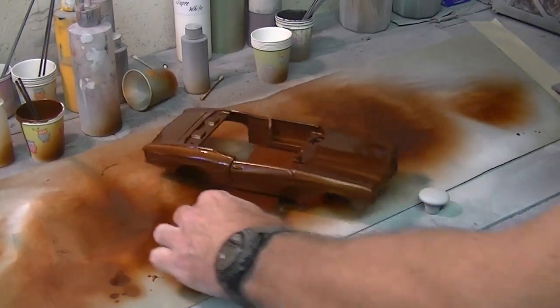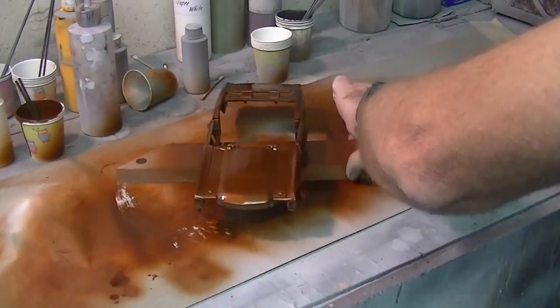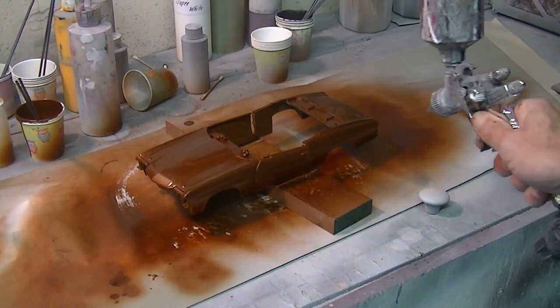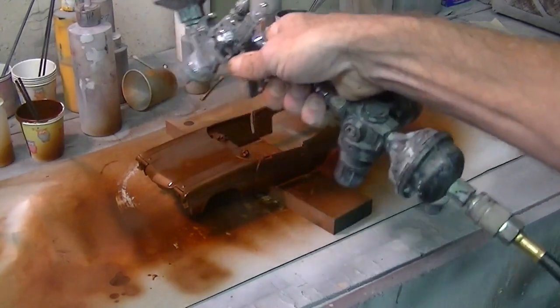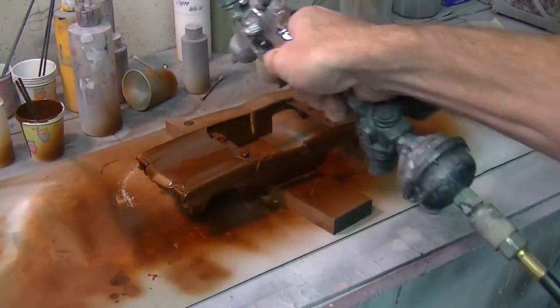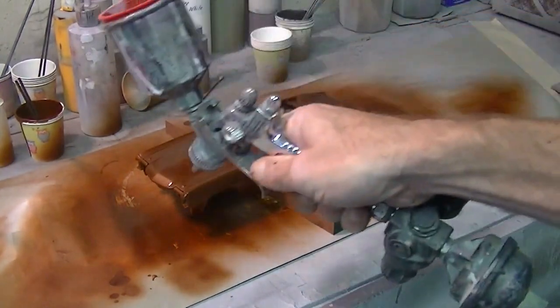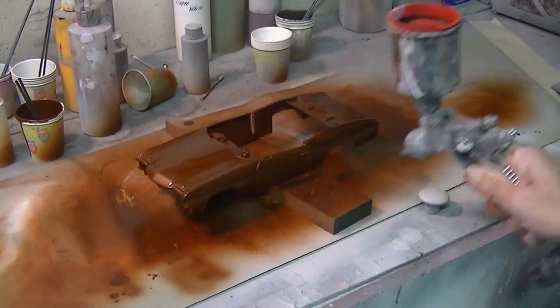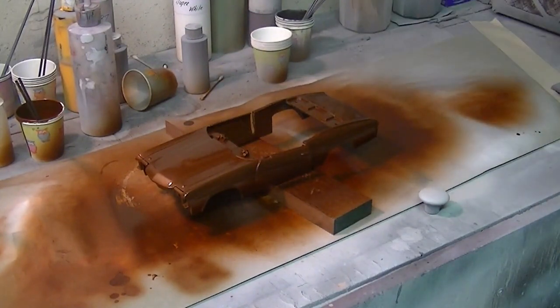Something I'll point out — on a car especially, you want the hood and the trunk to look really good. So when you finish spraying, you always want to end up spraying on the sides. You don't want to stop spraying when you're on the top because you leave a little bit of overspray that gets some texture in it and will wind up looking kind of rough. So as you can see in the shot, I'm going to work my way around and finish when I spray across the side of the model and not on the top.